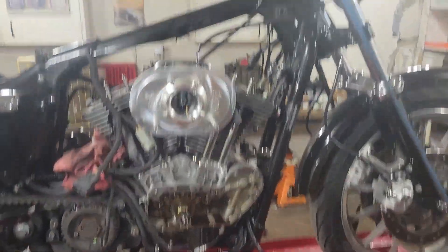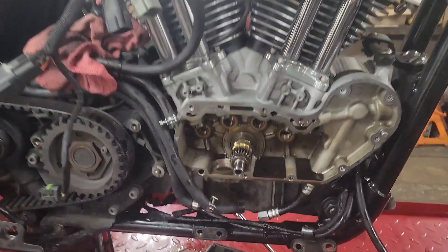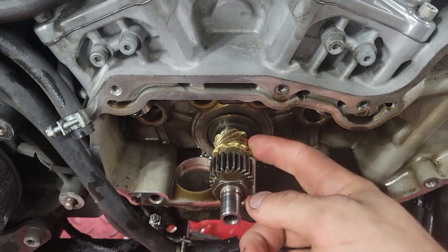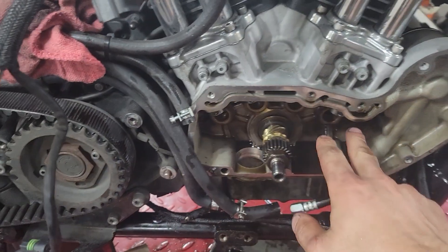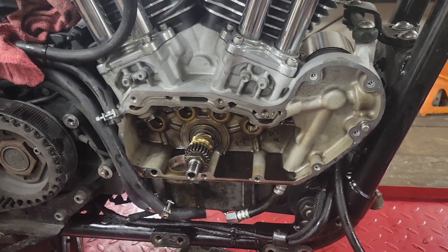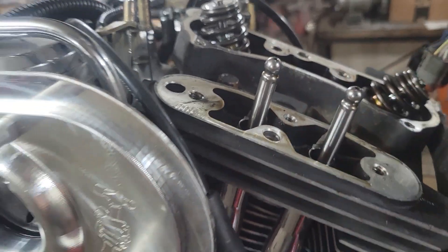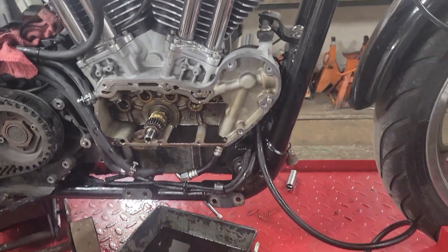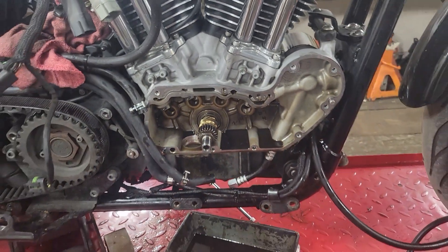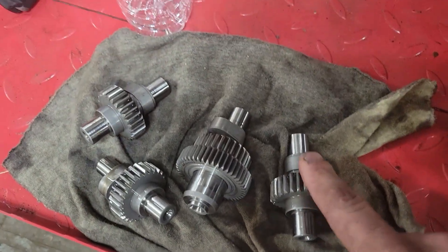Alright folks, so I tore it back down — not as far as if I was doing the whole motor. As you can see, the drive gear is absolutely gone. But all the cam bearings and bushings look good on both sides. The cam cover as well, the rockers look good, the arms and all that jazz, the push rod tips are good, they're not worn down. So I don't think anything happened to the motor, but we've got to get this gear off, get a new one, get all the gaskets, and put her back together. Cams are good as well.